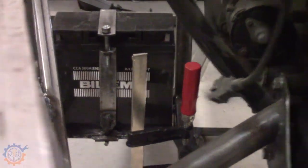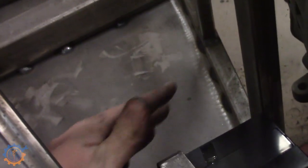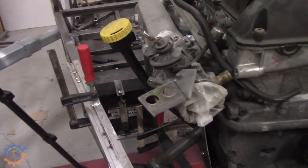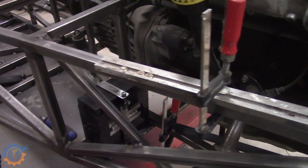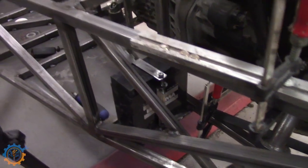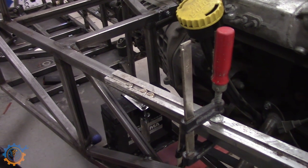If we look at the battery mount itself, you can see the bottom has the hook and it goes up, and it's screwed in place like that. I think this mount is actually working really good. On the back side there will be a plate that protects — that plate is towards the feet. You can mount the battery in the back of the car, but this battery is so small it's not really a weight gain. Instead I will be able to use very short wires, especially to the starting motor, because that one sits only 20 centimeters away — and I think that's really neat.